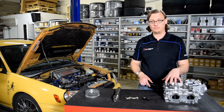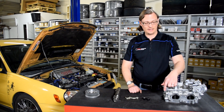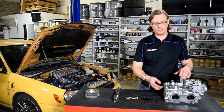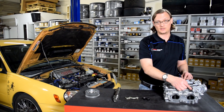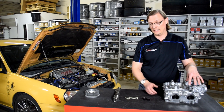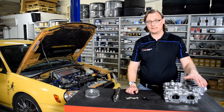The last really important piece of information is the AVCS lines and solenoids. Even though we're not running AVCS, you have to leave the AVCS lines and solenoids in place. The reason is that on these 2.5-liter heads, the oil flow that goes to the front cam journals comes from that AVCS line and solenoid. If you tried to delete those, you would actually run the front cam journals dry, and most likely the cams would seize the cylinder head. So even though you're not running AVCS, you still must run the AVCS lines and solenoids.